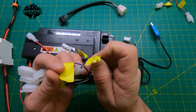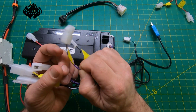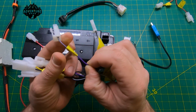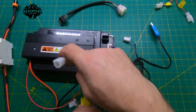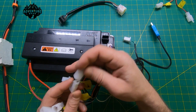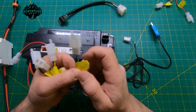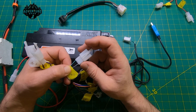The next one I have labeled as ignition — they also refer to it as the e-lock. It's the purple wire with the gray stripe. If you power everything up without this wire active, the controller doesn't do anything. But as soon as you activate this wire, the controller comes live. This is the one you'll want to run through your key switch.